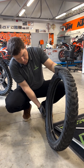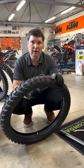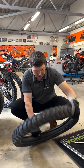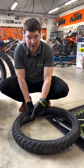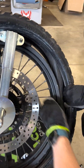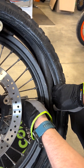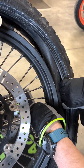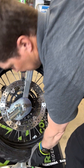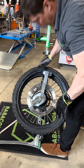So we check the direction which will go like this. There are different techniques to mount with an air tube. Some people put the first side of the tire on and then put the air tube through in between the tire. I don't like it. My personal favorite is to pull a little bit out, put some air in the tube so it holds form, then put my hand behind it and install the valve through the valve hole with the nut on it. Then I mount the whole tire together with the air tube. The first side can go up really easily — it went on by hands.